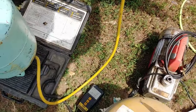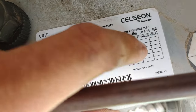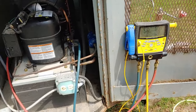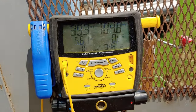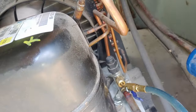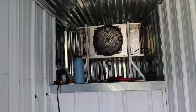After the vacuum holds, I'm going to add in a solid pound and then fire this thing up. I'm guessing it'll hold about three or four pounds. It doesn't list how much refrigerant it takes, so plug it in, power it up, put in the initial charge, and then we'll write what kind of refrigerant and how much it holds. High side pressure is coming up, low side pressure going down. The sight glass is very bubbly now and we've got good heat on there, so we're definitely adding more. I got the evaporator put back together except for the side covers so I can see how it's flooding — everything's starting to sweat nicely, which is a good sign.